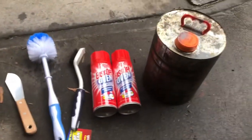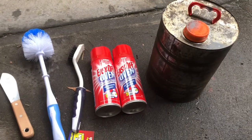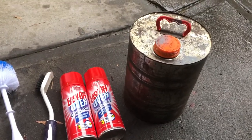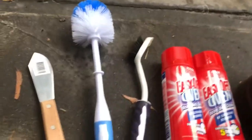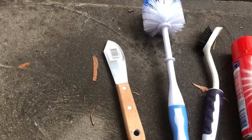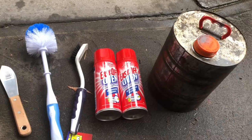There's been a bit said recently about what to use to clean the inlet manifold and throttle body - I thought I'd try a combination of techniques. I'm going to use petrol to soak them, let it soak, then use mechanical agitation with some brushes - probably a toothbrush as well - and a putty knife with a curved edge to scrape the throttle body. I've also got some oven cleaner, so I'll see which method works best and report back.